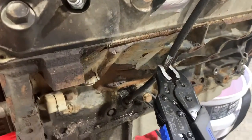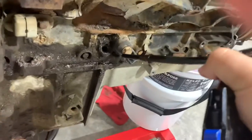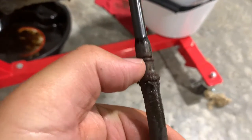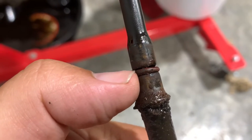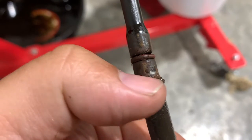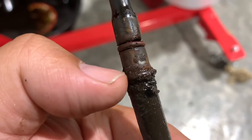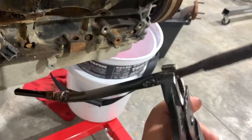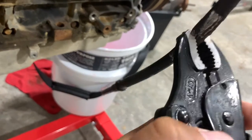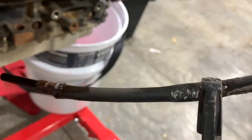Let's see if we can do the rest by hand. There we go — here it is. There's a little O-ring right here. It's kind of dried out and would need to be replaced, but that holds it in there and stops it from leaking. Where this tube is flared, you can see it's really kind of rusted up. That rust making contact with the block is what was holding it in. There's your unofficial tip for the day: if you've got a stuck dipstick tube, grab it with a vice grip, really dig into it, and then whack it with a hammer.